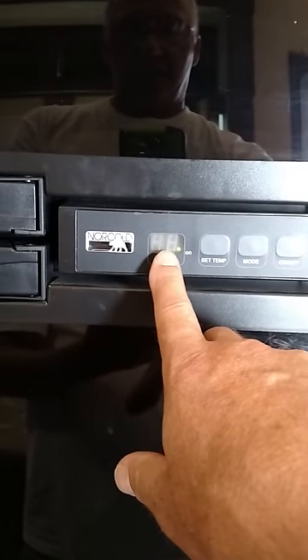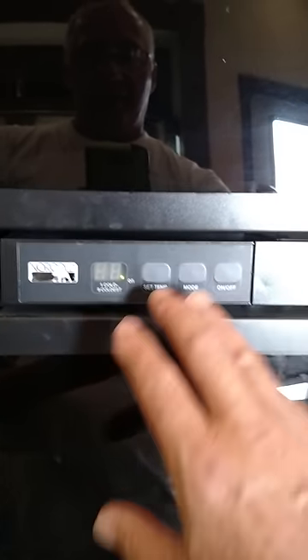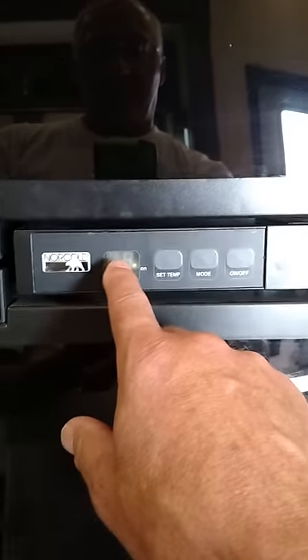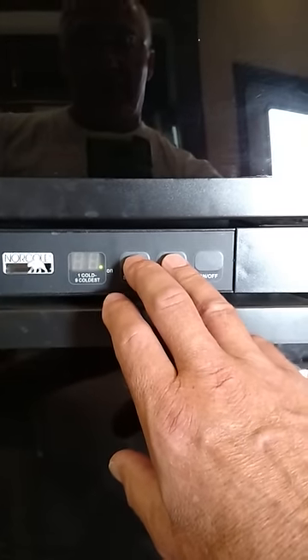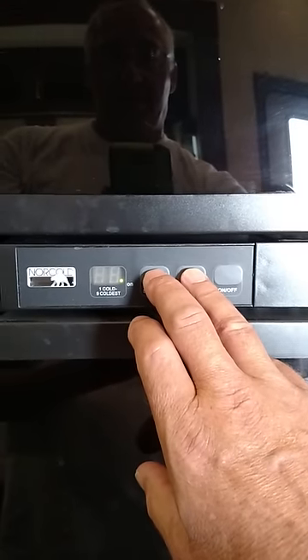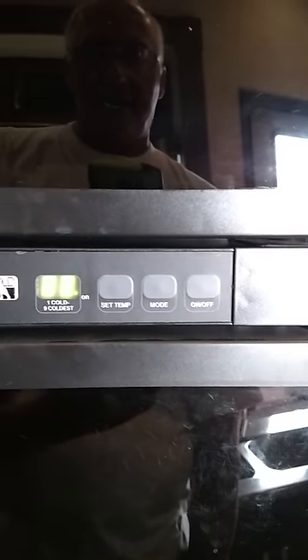To keep things simple, when you're pushing buttons here — especially when you're pushing two at the same time — wait until there's just a dot, because if you push them and there's still something displayed up here, you may be adjusting it unintentionally. So we're going to go into diagnostic mode now. I'm going to hold these two down and press them as quick as you can — just hold them down and wait until number one shows up, then release. There's the number one — release. You now have 88. You're in diagnostic mode.